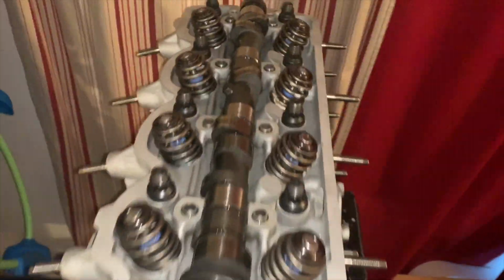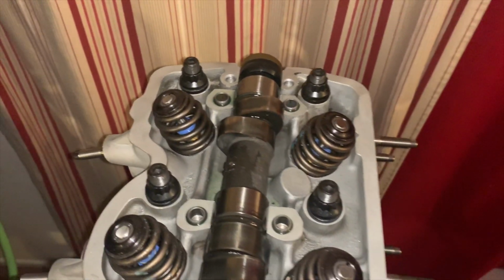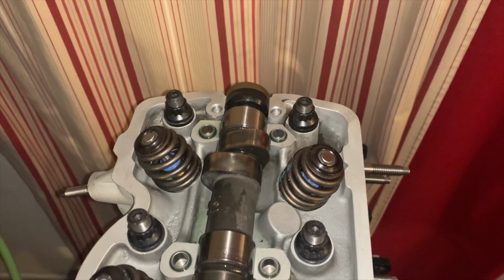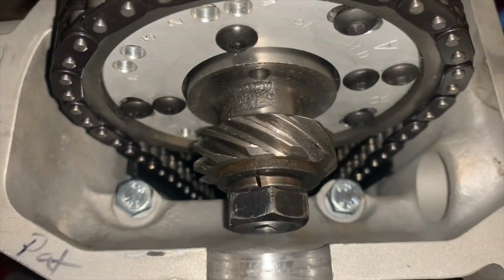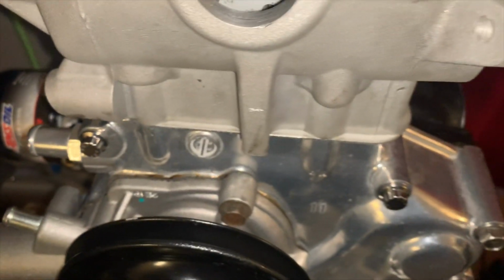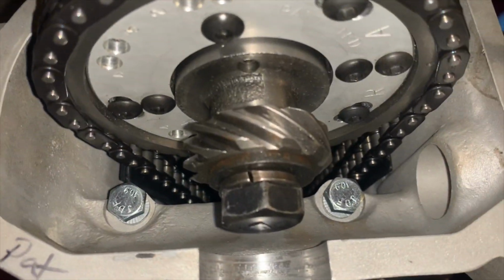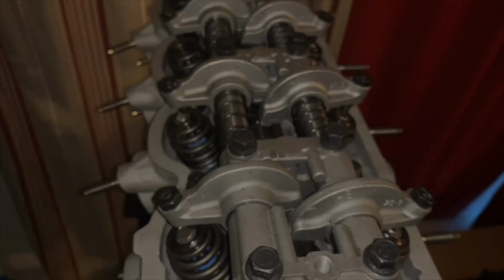All right, so we have received our new cam seal there, but we are not going to lay that sucker in until we get some silicone, so we're waiting for that. And here, these are actually not the original bolts, as you can tell, but nonetheless, because it's bolting into this timing cover, you can't over torque it, otherwise you're going to strip it. Same deal with these.